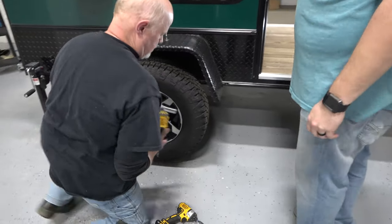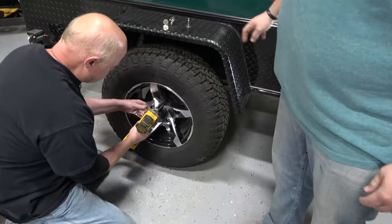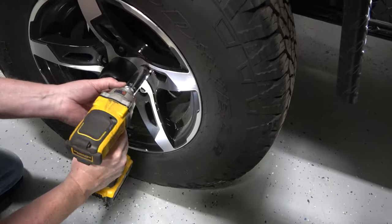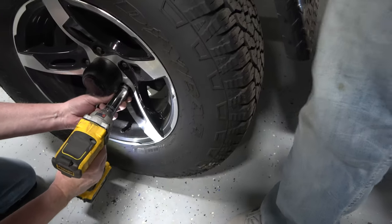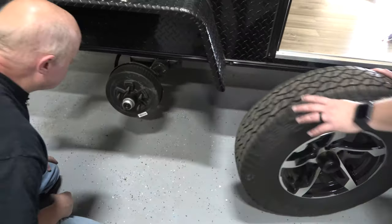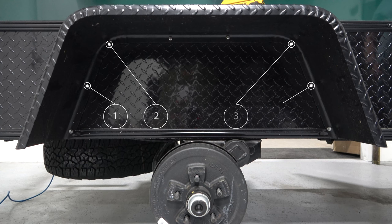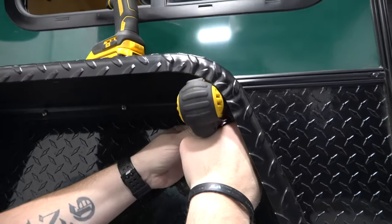Today Bill's going to help me out installing these elevator bolts — this could be a two person job. First thing we're going to do is take the wheel off. You want to replace these four screws with the new bolt hardware. Your exact screw location may vary based on the age of your trailer, but it is recommended to replace the screws as close as possible to this pattern. Remove the existing wood screws and drill out the new bolt holes with the quarter inch drill.